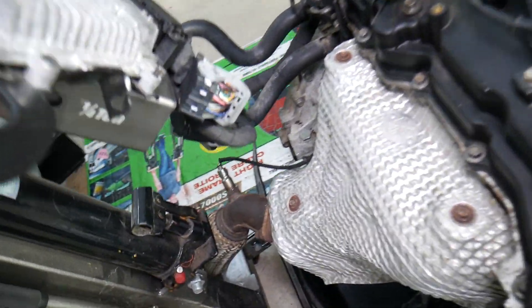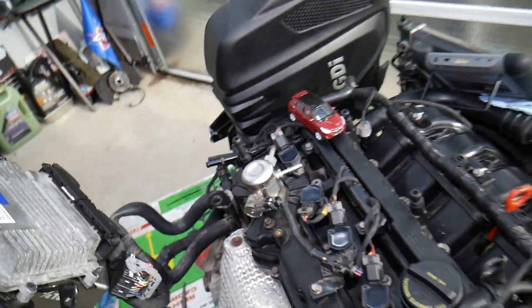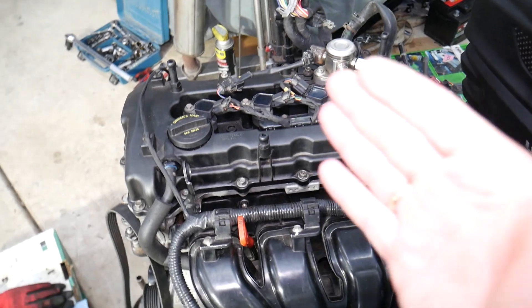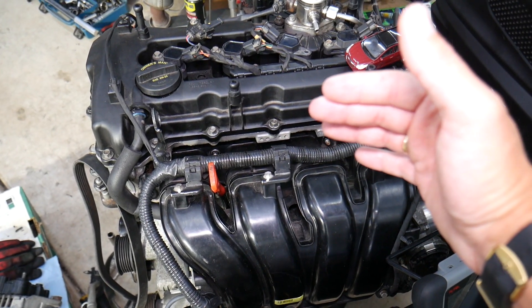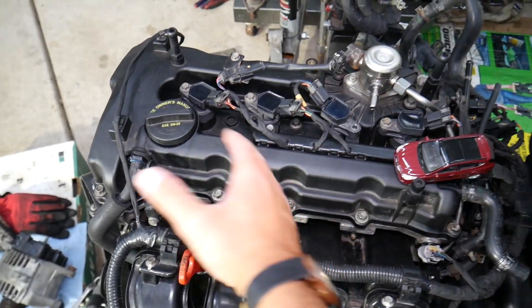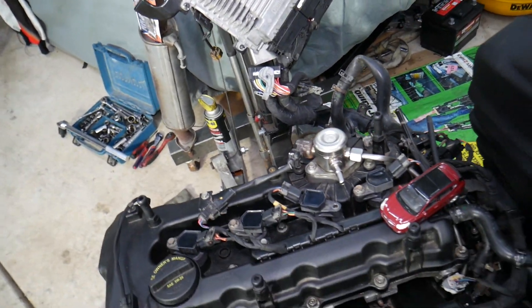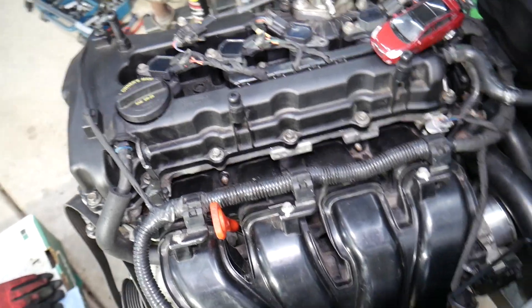For example, if you have a bad oxygen sensor — sensor one, bank one — it's just the oxygen sensor right here. Bank one and bank two terminology came from V6, V8, and even V12 engines, where the computer treats each side as a separate engine. For instance, BMW's inline six-cylinder engine still uses bank one and bank two — the first three cylinders are bank one and the second three are bank two, virtually dividing the cylinder head. But Hyundai just uses bank one. So if you have a lean fuel mixture on bank one, it simply means your engine is getting a lean mixture — you have only one upstream oxygen sensor and only bank one. Hopefully that clears things up!